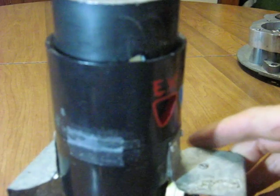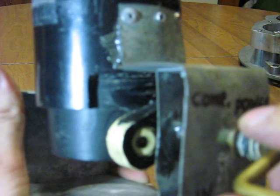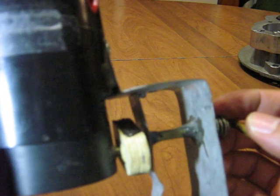This shows the drive ball mechanism. It's just a crankshaft that has a ball, and the sleeve has a little pin on it — you can zoom in to see the tiny pin that sticks off the sleeve into the ball. The reason you need the ball is because the sleeve not only goes up and down, but also rotates about 30 degrees side to side. The sleeve drive shaft drives the sleeve, and being a four-stroke engine, the sleeve drive shaft runs at half crankshaft speed, just like a camshaft in a normal engine.